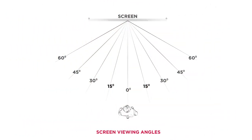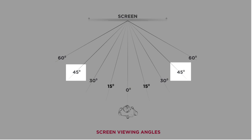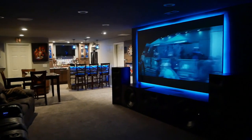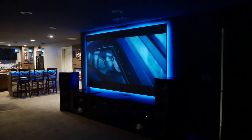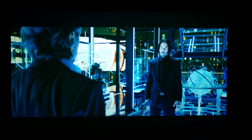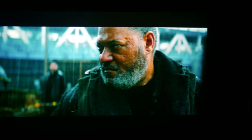This screen has a viewing angle of 90 degrees before you start seeing a noticeable difference in the brightness of the image. Higher gain and ALR screens will have a narrower viewing angle before the image starts getting darker, but from roughly 12 feet back, there was no noticeable difference in brightness from any of our seats. I did not have my Panasonic AE8000U professionally calibrated for this screen review, but after just a few adjustments, I was able to get deep blacks and a natural-looking image on the ALR screen. It's really hard to get an accurate representation of what the screen looks like with the camera — everything is going to look a little bit bluer than it really is due to not being able to correctly white balance with the lights on versus off, so just keep that in mind.